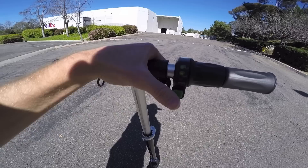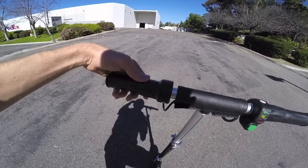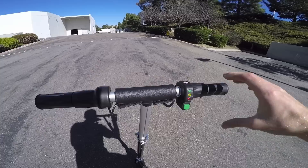Let's go ahead and power it up. I noticed it takes me a couple of presses — it finally stayed on. This is just a cheap piece of plastic; I've seen these on older electric bikes. With the twist throttles, they are kind of spring-loaded, and if you let go abruptly that click is hard on it. I wouldn't recommend doing that — I've actually had some of these fail on me. I'd recommend smoothly releasing it if you want this to last.